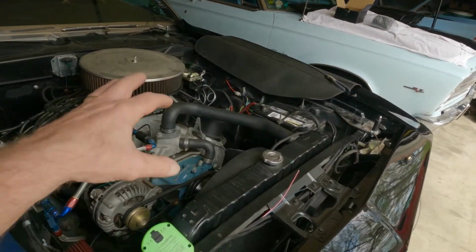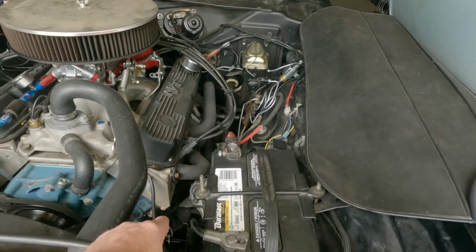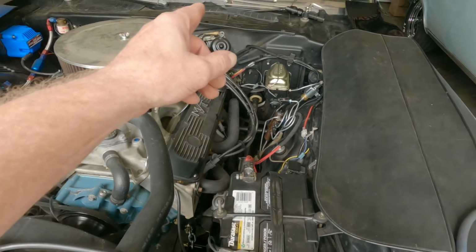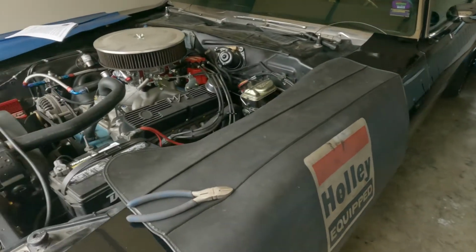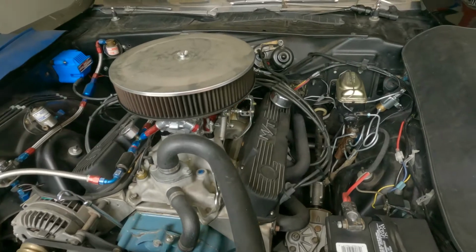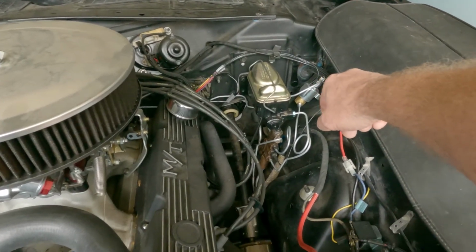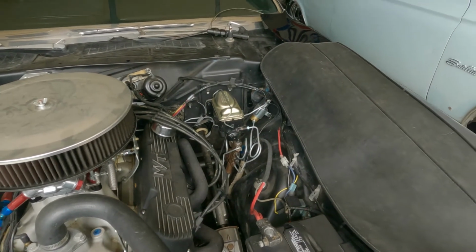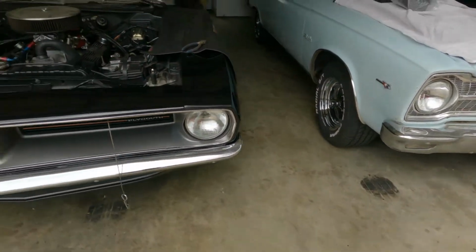I'm going to go to the drag strip with this car. On a previous video, I put in a torque strap, homemade. Put in a drive shaft loop. And I put in 3-inch stud axles in the back. Before, I had done a line lock, and that was just for funsies, just for being an idiot, a jackass, smoking your tires. And I did that quite well here in the garage. It's sitting right there and right there.